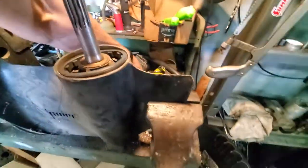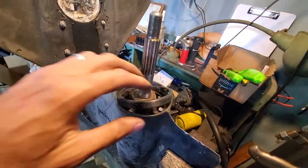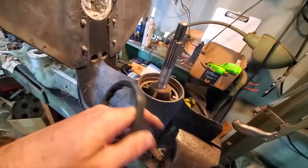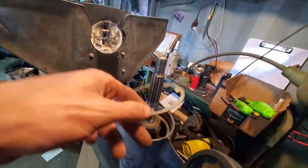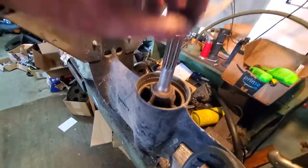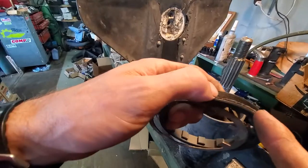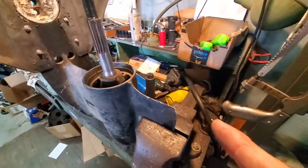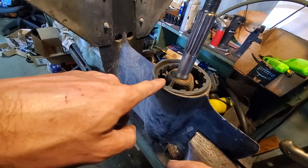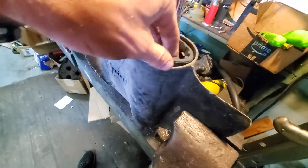Once you've got your oil in there, it's heated up, and your tool is in place — you're one of the lucky ones if you manage to unscrew this ring. Just read your manual because you might have a different locking ring type. Once you get the ring out, these two pieces sometimes stick and you have to pry them out with a screwdriver, but they do come out. Sometimes these are so stuck that you literally have to drill them in two or three places and break them up — that's serious duty but it is possible.